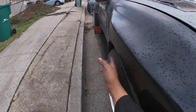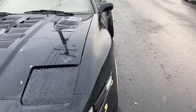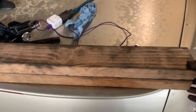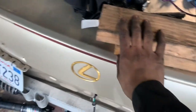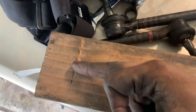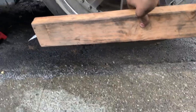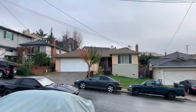I have both sides done. There's a little bit of toe out on both sides. I don't have any toe plates, so I'm going to make my own. I'll line them up, put a couple screws in between to hold them together and keep them even, cut one side to make them even with a sawzall, and slit it enough so you can put it on the floor on both sides of the wheel. Then you put a tape measure on both sides to get your toe reading. It's raining now so I'll make these and come back outside once it stops.